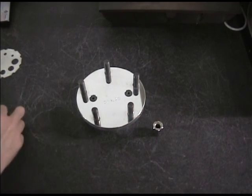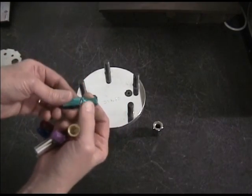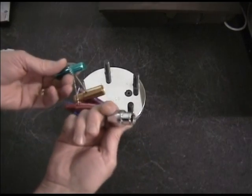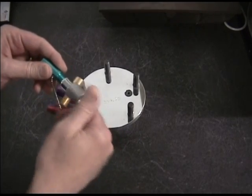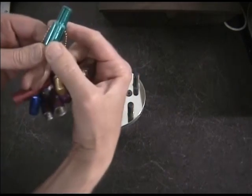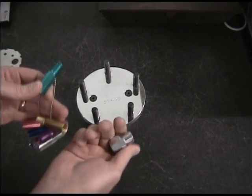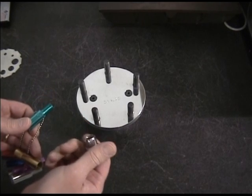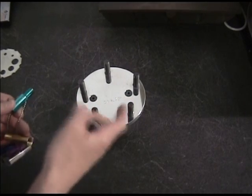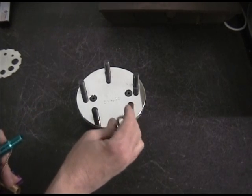There are a number of ways to do it. One way is to get one of these kits that has a number of these little devices which simulate the stud end and the nut end. You can take the nut and screw it on to check the fit. That one happens to fit, and it says it is a half-inch by 20 right-hand. Nearly all studs are right-hand, but there are a few that are left-hand, so you have to be careful. If they are left-hand, typically there's an L stamped on the end of the stud, so look at that before you decide which way to turn. Again, 90% of all studs in the automobile world are right-hand.